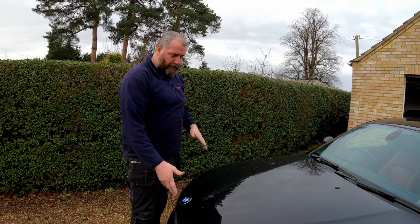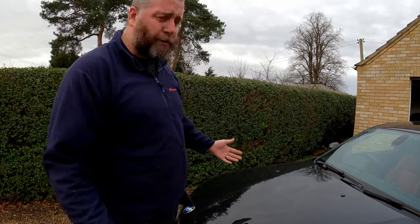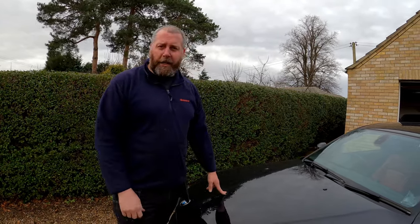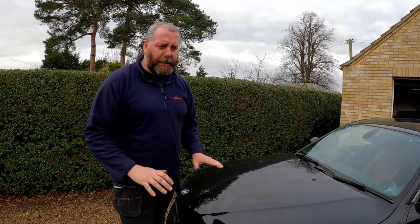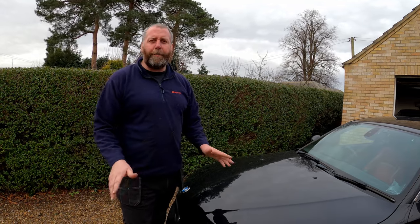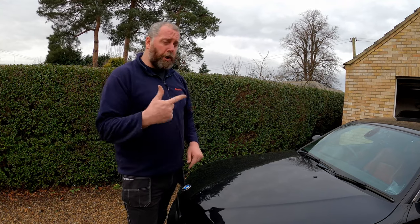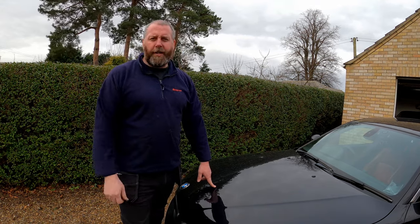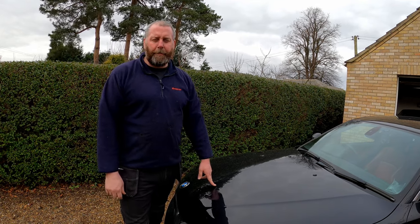It's always nice when you have these little issues that can get fixed for very, very little money — which in this case wasn't even £15. The car's back in action. So yeah, if you have a very similar issue whereby the car thinks it's overheating but you can see absolutely no evidence of any coolant loss or any problems — particularly if you've had a recent water pump or thermostat — then I would look at your coolant temperature sensor. Anyway, I'm going to end this video here. I hope you enjoyed it — if it helped you out, let me know in the comments below and I'll see you all again for the next video. Take care, bye-bye now.